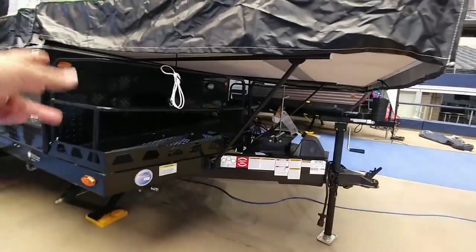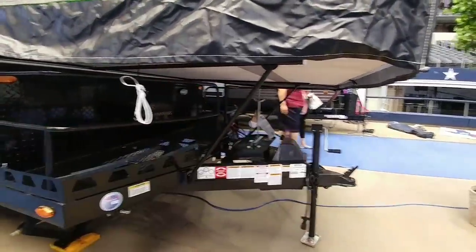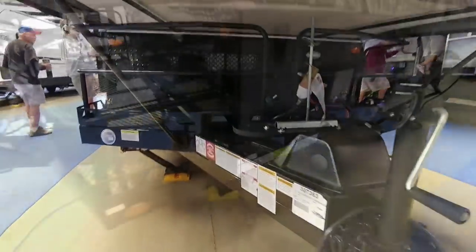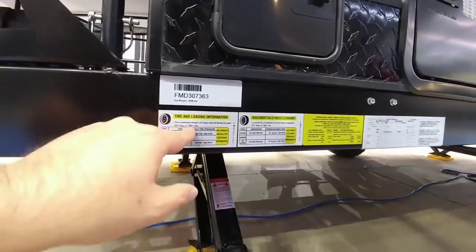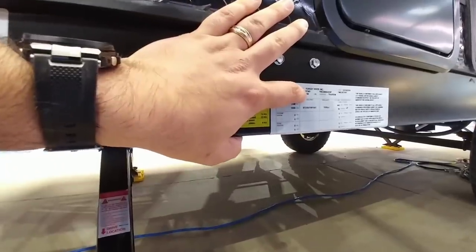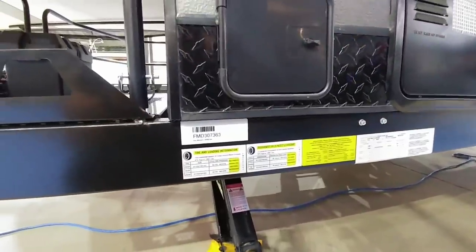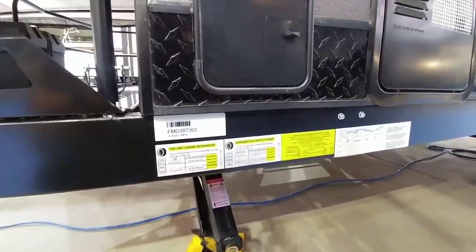Something else that's real nice is you have all this storage in front between the front of the RV and the actual coupler — to store things like bikes and other items. It holds dual propane tanks and has a manual jack. The cargo capacity is 1,263 pounds with a gross vehicle weight rating of 3,838 pounds. This is a relatively heavy pop-up camper, easily half-ton towable — even a small compact pickup like a Canyon or Colorado could tow this.